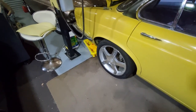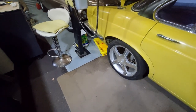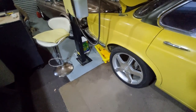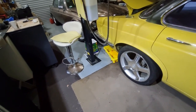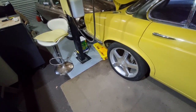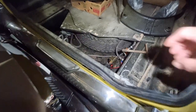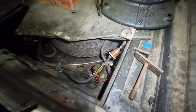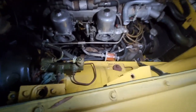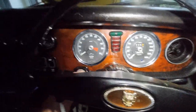Update — everything's back together. I pulled apart the fuel sender unit, gave it a good clean, and tested it on the bench with my multimeter and it's working. We put that in with new gaskets — new gaskets at the bottom. Five litres of fuel went in, wheels back on, I've had the pump running and the fuel's clean. Nice clean fuel up to the front filter, and she pretty much started straight away.